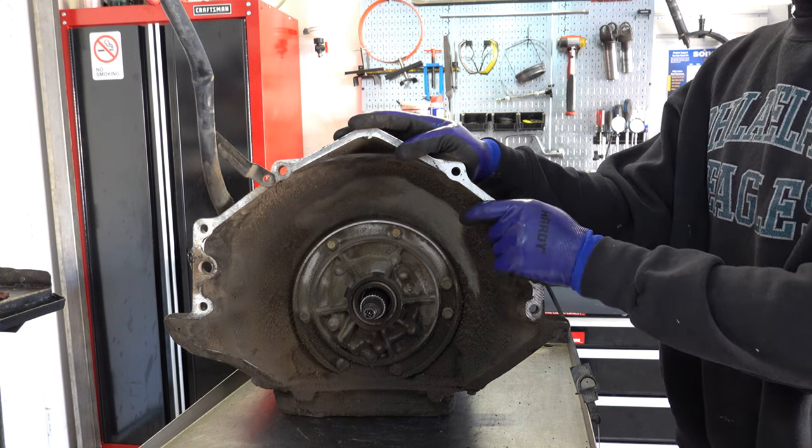So if you're looking at this piston on the bench like this, and you have an early generation 700R4 low reverse piston next to it, you'll notice that this is shorter by eye than the early generation. Like I said, that was to allow for the addition of a cushion plate underneath the steels and clutches to soften engagement in reverse. I could have said that a lot smoother. I more or less butchered that explanation, but that's what it is.